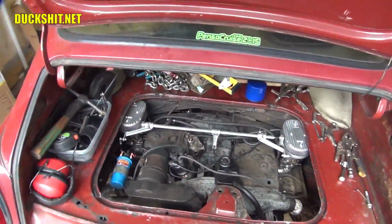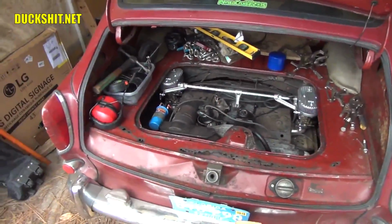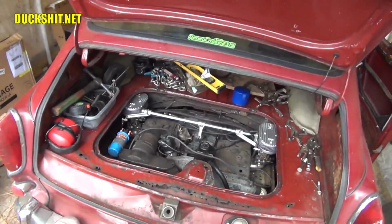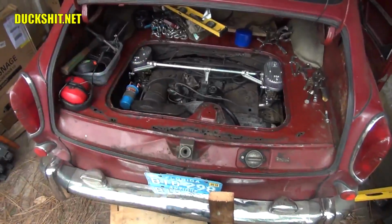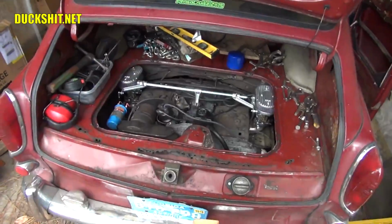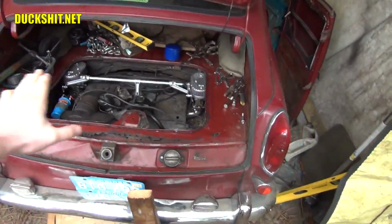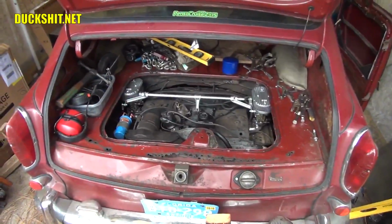As I said, when I was doing the work to bend this flange, you wouldn't believe how hard it was to get this metal to bend. I made a special hook and I lifted the back of the car up by the flange. The back wheels were off the ground by only about an inch or two. And I was bouncing on the back of the car until finally the flange would start to give and bend. Then I would move over a few more inches and hit it again and get it to bend. The flange came up, and I was thinking roughly half an inch is all I really needed. And that actually is what planed off the floor. When I put a straight edge across this, it's pretty straight. But I needed about that half inch in here to make that work properly, and it seemed to do the job.